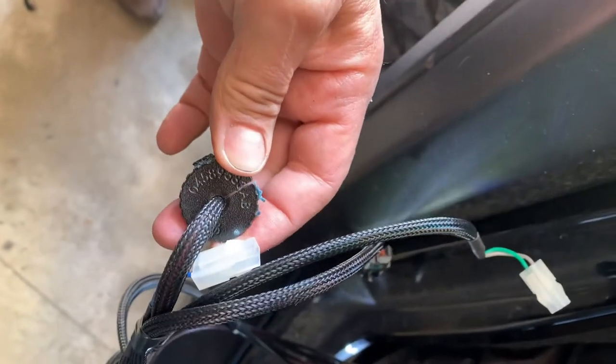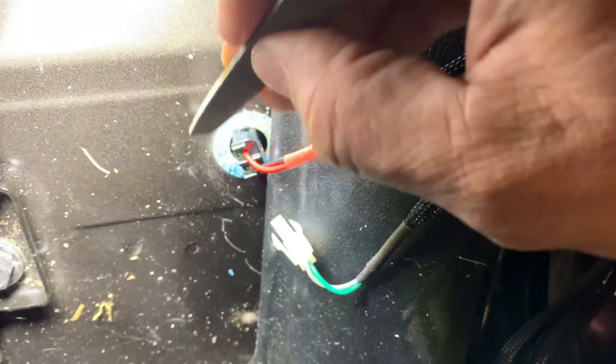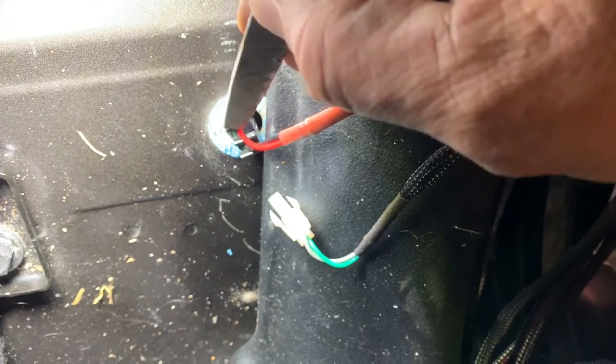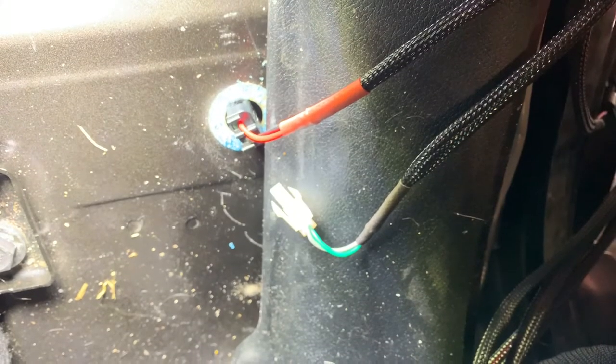On the passenger side plug, same thing — cut it, slit it. They knew this was going to have to be filed to fit. You can get all the way through this opening, but when you get to the back side of the connector, these little corners right here are going to have to be filed in the body pan itself. It would have been nicer if these were left unpinned so you could stuff the wires through the hole and then put the connector on — that way there would be no secondary work needed.